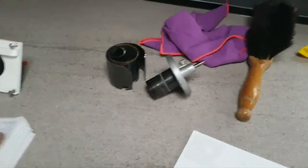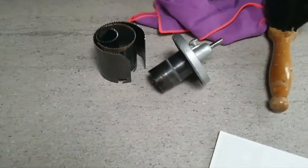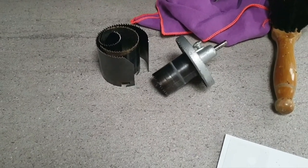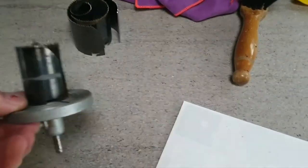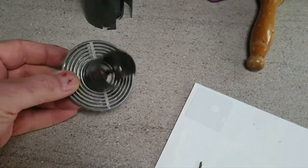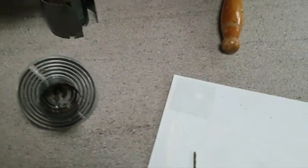This is what I'm using to cut the hole through the wall. Typically on these motorhomes the composite board is about 25 mm thick — about an inch thick — so I'm using this hole saw, which is about two inches deep, so it'll go through the wall easily. You can get these off eBay and they come with assorted blades, giving you a multiple hole saw so you can pick which size hole you want.